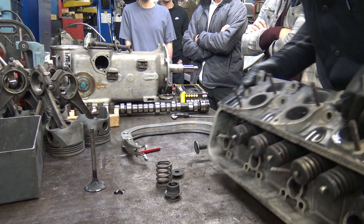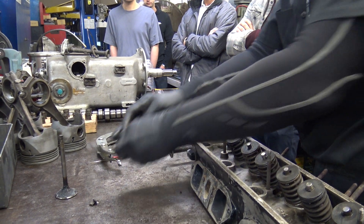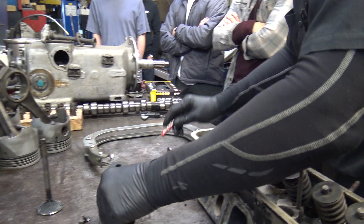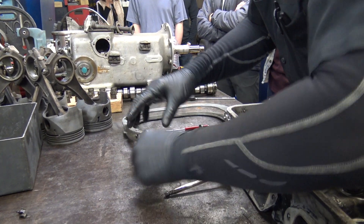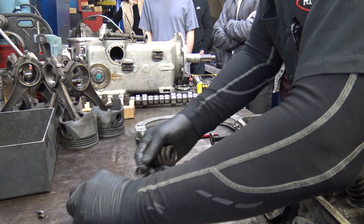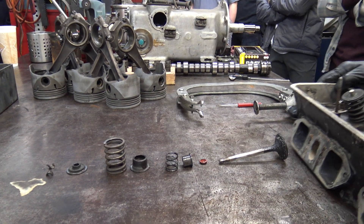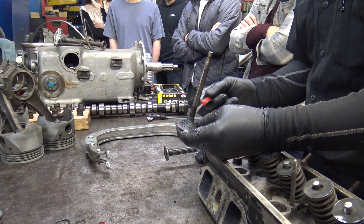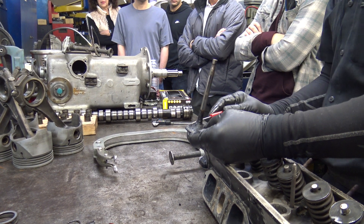There's an intake valve. This is the proper assembly — this is not a factory seal, but it was commonly used. What you've got here is the valve; it goes up and down, and it's pretty oily here, so it's been slipping by. You can see there's carbon buildup here. I've seen them where they build up almost all the way straight across, and then they start getting on the seat, and then you start losing compression.